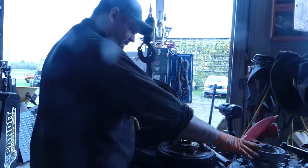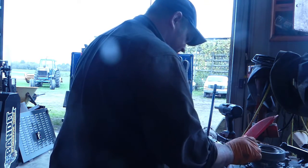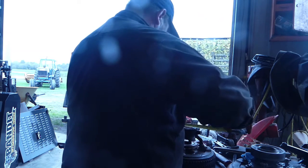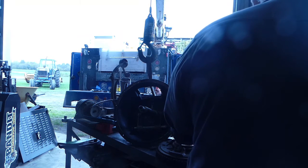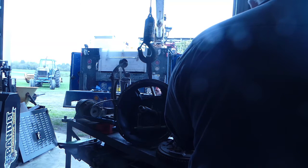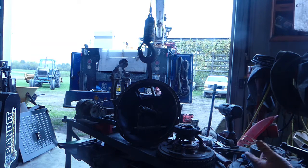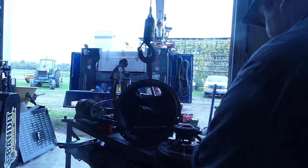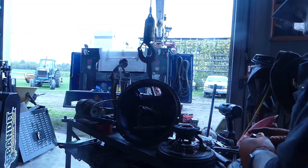Got that in place. We're going to check the differences here. We look to be the same. Everything looks very similar. Shaft size looks the same. Across the fork, 6 5/8. 6 5/8. The center of the bearing there is 2 3/8. Same, 2 3/8. Spline wise looks to be the same. A650-06BAM, same part number on it. I don't see any indication that we have the wrong one.